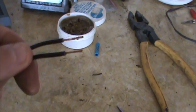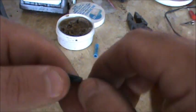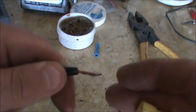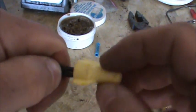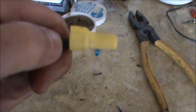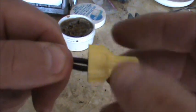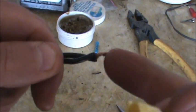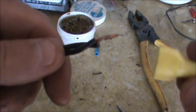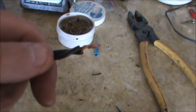Another way to connect wires is using a wire nut — twist the wires together and wire nut them. However, I wouldn't recommend this on a lawn mower because of all the rattling; the cap could fall off. You could solder and tin it first then put on the cap and tape it, but that's still a pain.